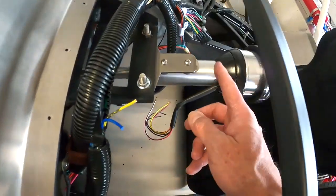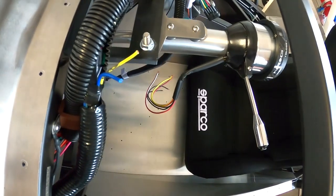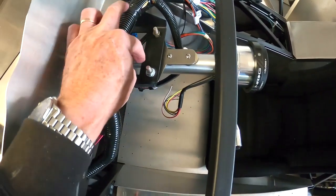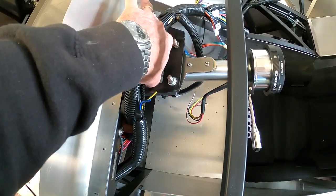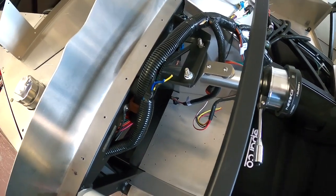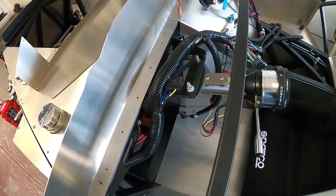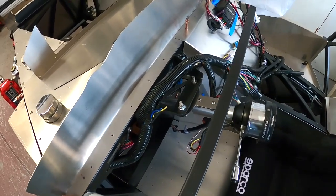So I picked up my half an inch here. I'm going to redrill these holes back and pick up another half an inch. It feels better, but it's still not quite right — I still need it to go a little bit further. If that's not enough, I think I'm going to have to weld in a plate here, which I can probably do easily since I've got spacers. I'd just weld a plate in and pick the bolts up from underneath. Why Factory Five doesn't put a slotted bracket here is beyond me — it would make life easier for people wanting to add quick releases, a Russ Thompson turn signal adapter, all that kind of stuff.